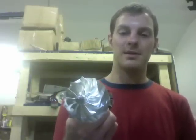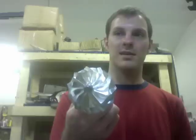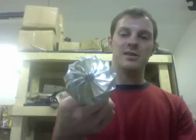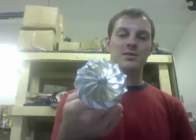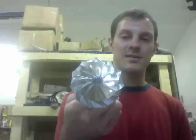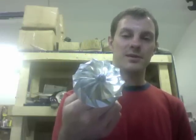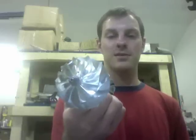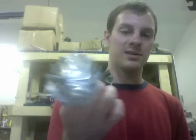The 3076 is more ideal — you could put this on a 2.0, you could probably put it on a 2.3, but if you put it on anything bigger than a 2.3, you really should use a 0.82 or 1.06 exhaust housing based on the size of your engine. If you're using this for a six-cylinder, it should perform really well with a 0.82 or 1.06 exhaust housing, and you can expect 550 horsepower plus out of this turbo.